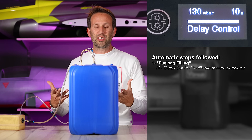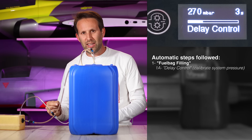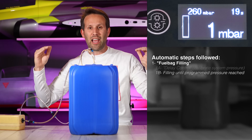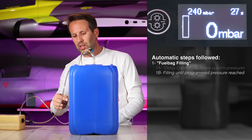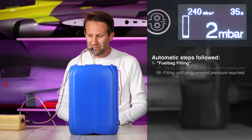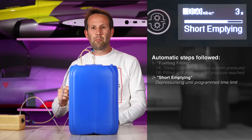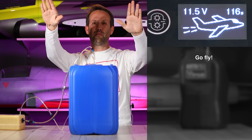Let's check it out. This time it can go straight in. Just like before, it's going to calibrate how much pressure it takes due to the system itself — all the tubes, the clunk, the tank itself — and then it continues filling, measuring the relative pressure compared to that base level. As soon as our fuel tank fills up — it's about halfway there now — once it fills all the way and the fuel reaches this reduction, that pressure is going to skyrocket. It knows it's full and we're done. It then pulls back just a little bit to prevent any dribbling. And once again, we've got our airplane telling us that we're good to go fly.